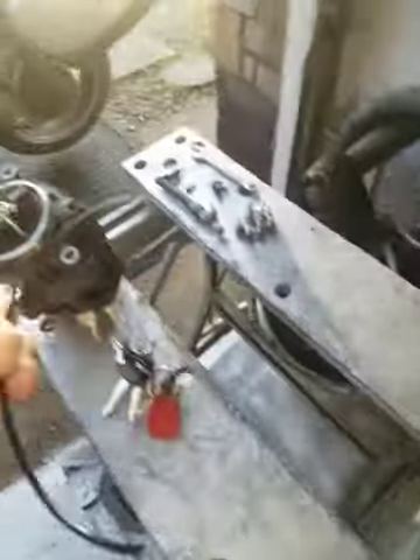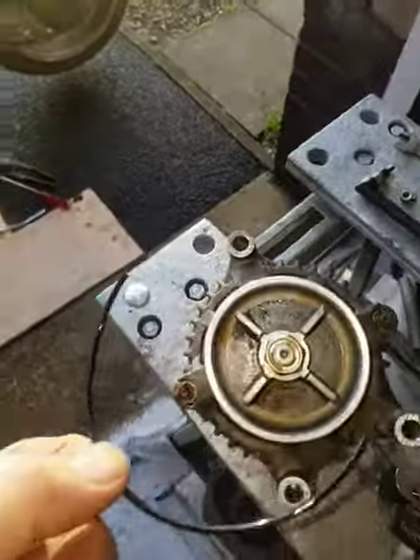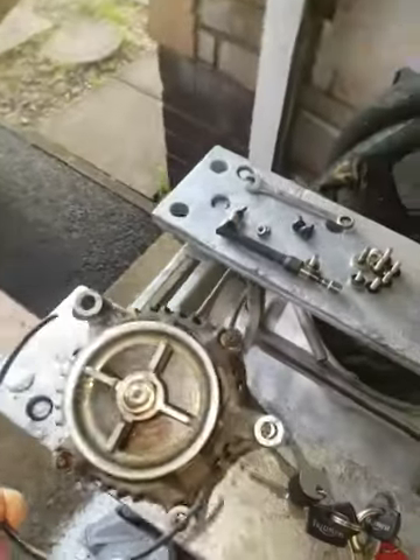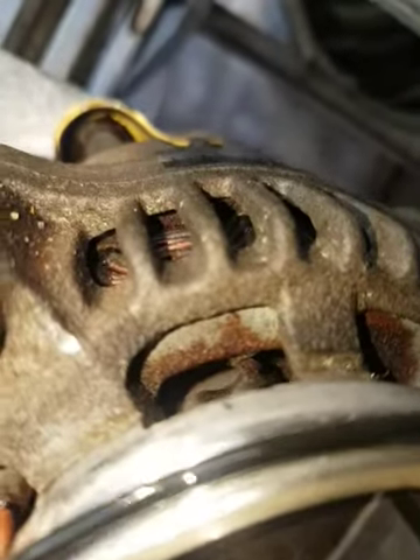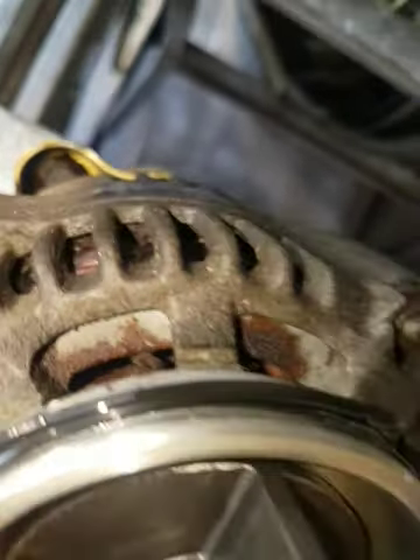So, here is the failed O-ring. The problem is that in order to get this wiggled in to the hole, it rides up out of the slot and then gets sheared.